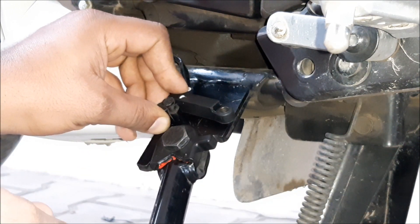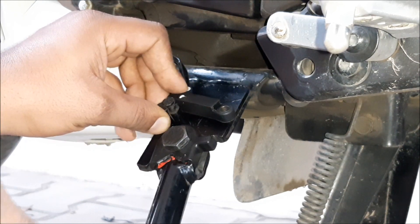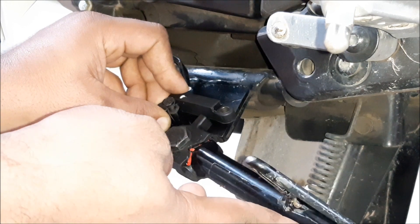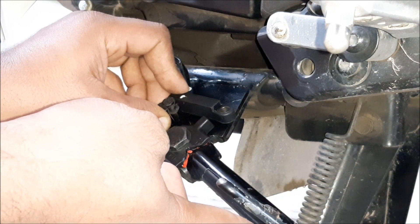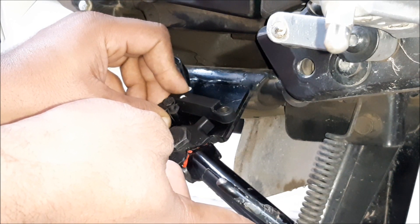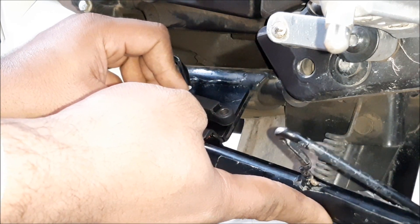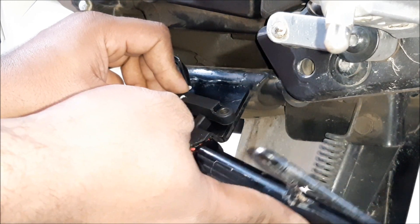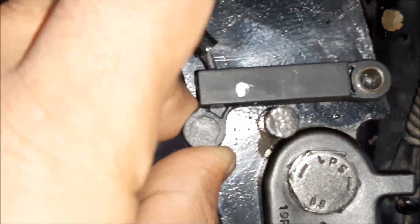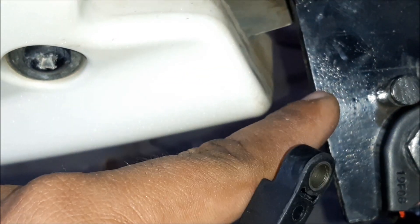As you can see and hear, as soon as the magnet goes near the switch the beep sound switches off. Right now the stand is not fully closed, so I still have some angle to go up. This mounting range is sufficient. To mount the switch, I have to make a hole and one small notch-type hole in the metal.